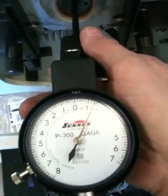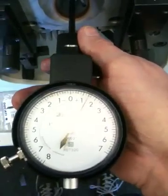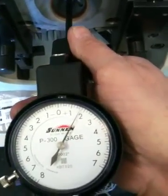So I'm not very keen on replacing the stock guides in the heads, because there's no sizing — you have to live with whatever size they come from Ducati, and they're just not right.